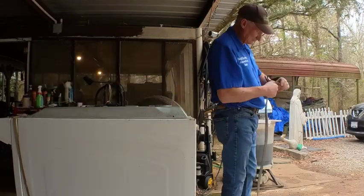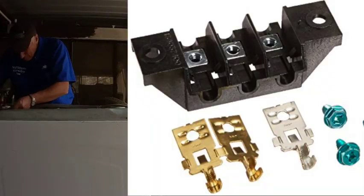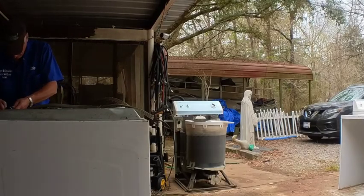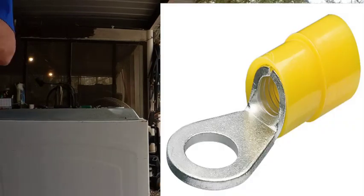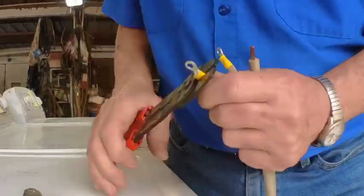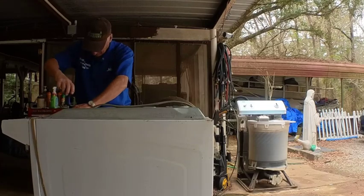I usually give $20, but there are a lot of issues with this machine. The first issue was with the electrical cord — it had a lot of electrical tape on it. So I wound up having to change the terminal block on it, as you can see here. It was kind of challenging, but I got it done and put a new terminal block on it. And then the wire itself needed new connectors, so I put new connectors on the power cord and salvaged it instead of putting a brand new power cord on it, because the power cord is in pretty good shape. And then I got everything back together.